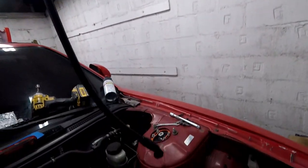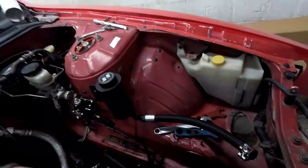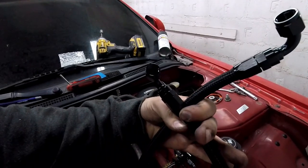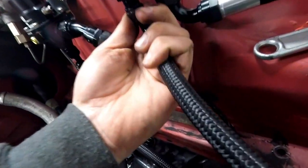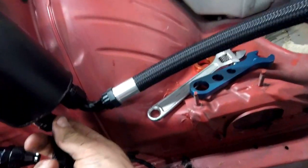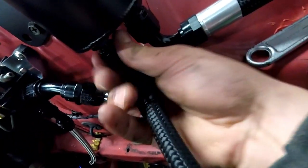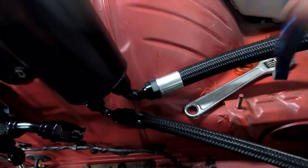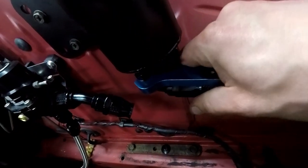These two are going to stay free for now. This is the high pressure line to the power steering pump; the thick one is the low pressure line to the power steering pump. Without an oil cooler this line would go right onto here, but since I have a power steering cooler, this will go out there to the cooler. The two cooler lines are both dash-6 AN lines — both have 90-degree fittings on both sides, so it doesn't matter which side goes to the cooler. With aluminum fittings, you never want to overtighten using steel.